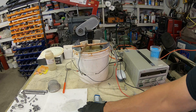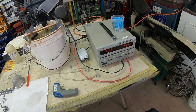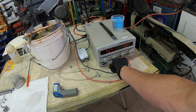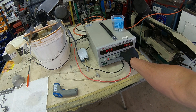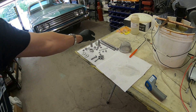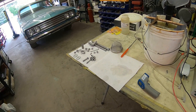I've got everything hung — I was able to get everything on the bar for the F7. Now I just come over and turn my power supply on. It'll come up and I'm at about 2.3 on my amps and about 0.4 to 0.5 on the voltage, so that's probably going to be okay. As for how long to plate these parts — most of them, probably a half hour. The big parts, like the big swing arm bolts and the axle bolt and maybe the brake lever, may be 40 minutes. It's just up to you; you've got to do some trial and error on it.